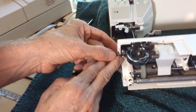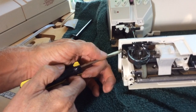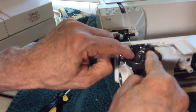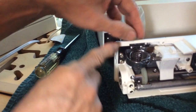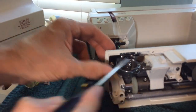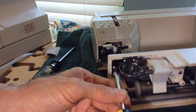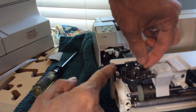This piece here needs to come off as well. So you have two screws here — get a good look at it. You might even put a little piece of tape across here so that you can see how it goes back. Get a good look at the gap right under here. This part here keeps this from spinning — so this is a stationary part, and this outer part is what turns. It has a little retainer right in there that prevents this from turning. Note the tolerance on that — the gap here between that — because this part does slide up and down. Mark it with tape so you'll know where it goes back.